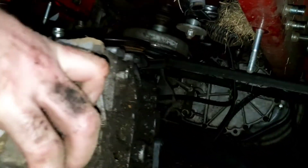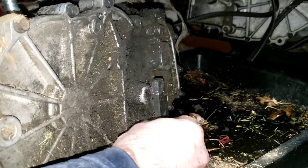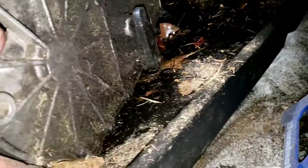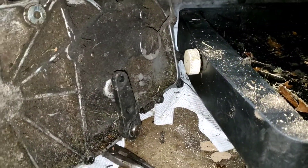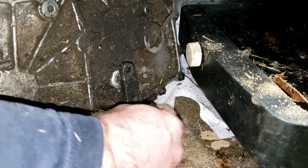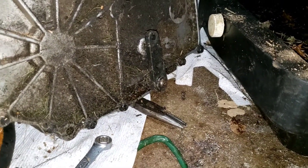So see this linkage right here - the thing that goes through it is a cotter pin. You can see it's wiggly - that's what's leaking: the O-rings on it. Pull this out - I'm going to show you what it goes to. This arm right here, the cotter pin goes through it at the top and that goes there. Look at that thing - it is wobbly. It's just a snap ring there.